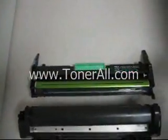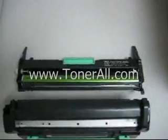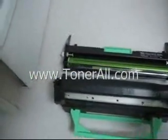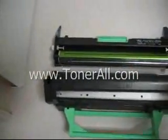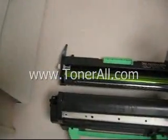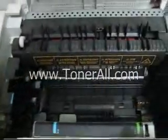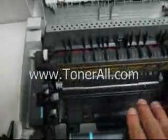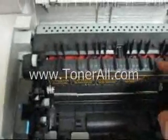You could actually see the images on the drum if you were to pull everything out and stop it during the middle of a print job, which I don't recommend. What happens is, as the image is written onto the drum, the paper goes through. It would be precisely timed so that the image is transferred as the paper comes through — transferred onto the paper. As it keeps going for the rest of the page, the paper is going to keep moving and come through what is called the fuser unit.